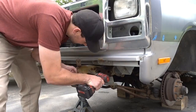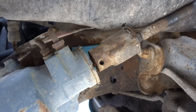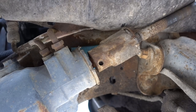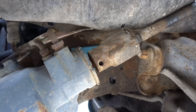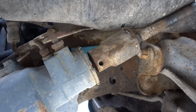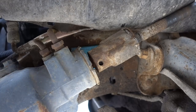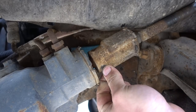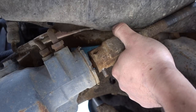What we've moved to now is messing with the first gen, because we don't really have an exact plan for today — just kind of doing whatever. I have a steering shaft, and I told you the steering shaft on this thing is pretty much completely shot. Tips and tricks to removing it: everything I've read says the lower part is held in by this roll pin and you're going to have to fight with it quite a bit to get it out.